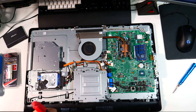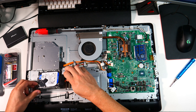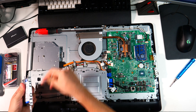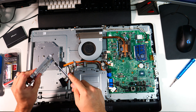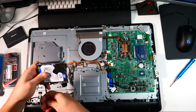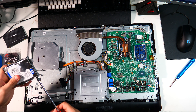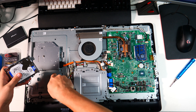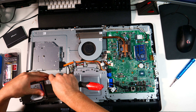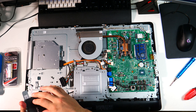For the drive swap, there's a single screw on the left-hand side holding the drive in. Pop that screw out, slide the drive backwards toward the motherboard, then lift the whole drive caddy out. Unplug the SATA and power connector — it's all one piece. Then remove the three caddy screws. They're the same size as the one holding the drive in the machine, and they're ferrous so your magnetic screwdriver will hold them nicely.